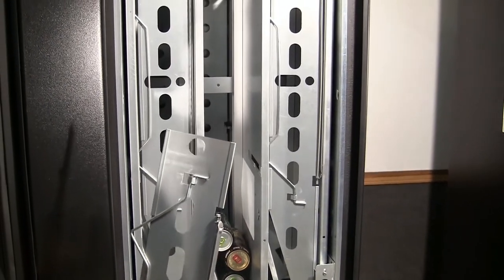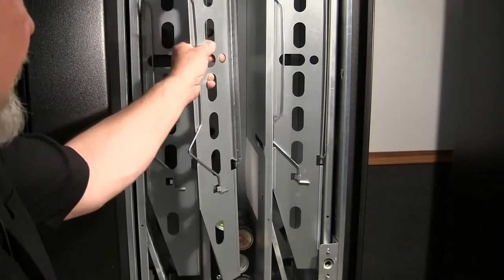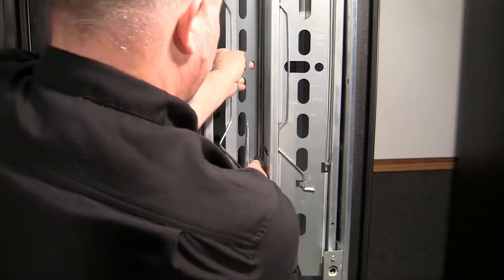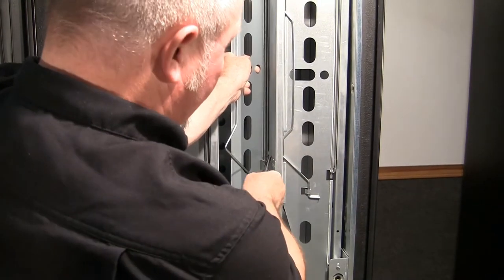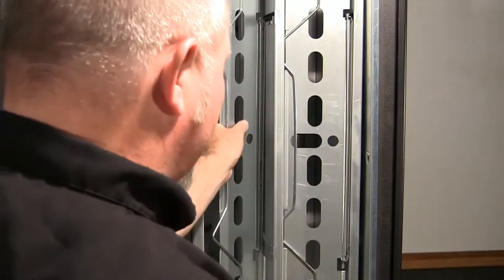Reinstalling the gate within a quarter inch of the product, whether it be a can or a bottle, locate the tabs on the sides of the machine, and again it may be possible to pry the tab out gently and snap the gate down.